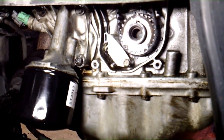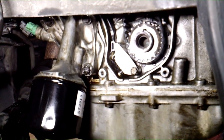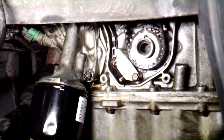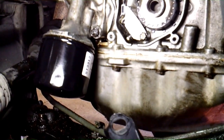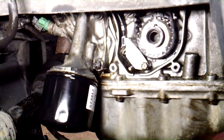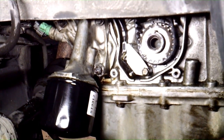We've got an oil drain plug leaking and the oil filter adapter housing leaking. That torque spec is 16 foot-pounds — pretty easy job. The hardest part is probably going to be disconnecting your electrical connectors, especially on an older car — they get kind of hard to disconnect sometimes. Anyway, that's it — changing out the seal on a V6 Honda 3.2. It's pretty much the same on all Honda V6s, very similar to this. We'll see you on the next one. Thanks for watching, God bless.